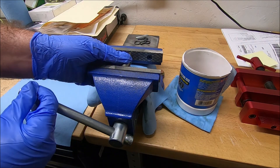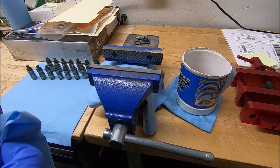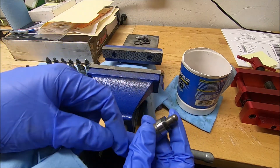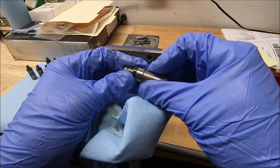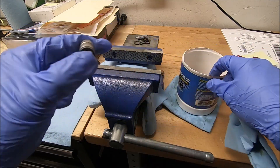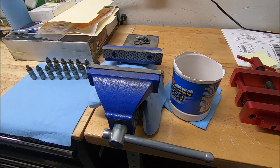We can release it down. So we did a little bit more than a full rotation around. Now we'll wipe this down. When you inspect these, you just check for any wear that's on there — if anything's loose on it, excessive wear on the top of it, or anything like that. Now you can see that it plunges down a little bit. I'm going to have a container of oil that I'll stack these in once they're done being bled down.